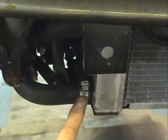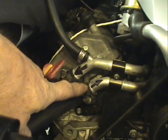The way it all works is the cold water comes out of the bottom of the radiator on the left, goes immediately into the pump with large diameter piping, goes straight up, comes right up here — and for everybody's benefit I made a little bunch of arrows — goes into the intercooler, comes out of the intercooler, and runs straight back down, comes underneath the car, and we put it right here so that it sits underneath. Got a couple of clamps that run across the bottom of the main brace, comes across again, comes back inside the main brace, and straight up. Real simple, real short, no big hard bends or anything like that.